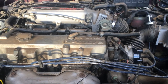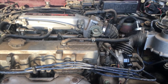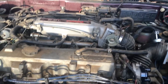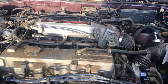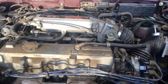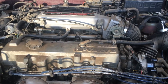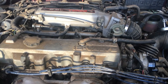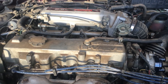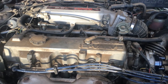Hey, this is Ben's channel. We are working on the 1989 Ford Probe 2.2 liter intercooled turbo. In the past we replaced the fuel pump because that had been a known issue. This time we were trying to diagnose why it still won't start, even though the fuel pump is new and we knew we had fuel pressure because we had tested that.